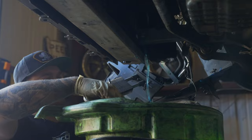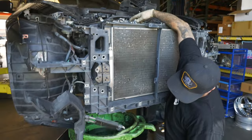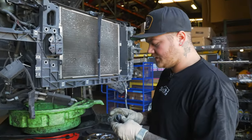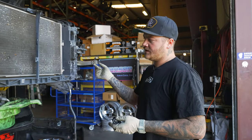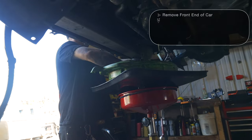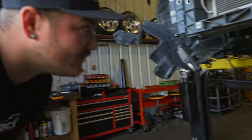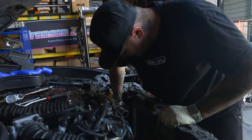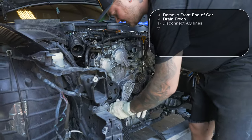The coolant is trickling out — it'll take forever, but if you reach up and grab the coolant cap watch how much faster it goes. That's basically just making airflow so it's not creating suction. His coolant looks really clean but he wanted to do a coolant flush too. He's also got that coolant leak on the back of the motor, so we'll kill two birds with one stone. He's got a little magnetic drain plug too — when I pulled the drain plug out it stuck to the pan and I got nothing on my hands. Now I'm going to disconnect these two trans cooler lines and the radiator is ready to come out.